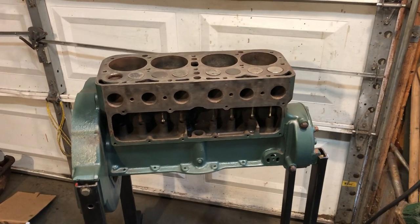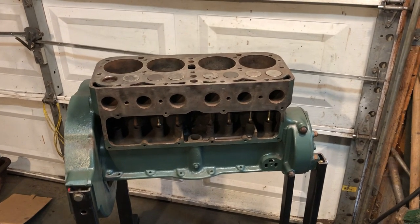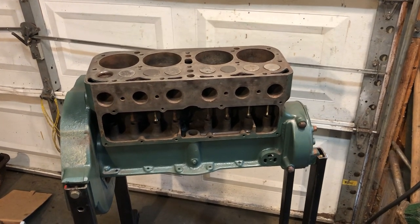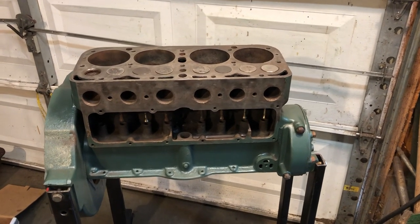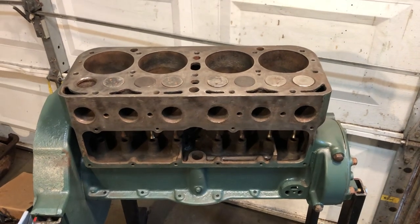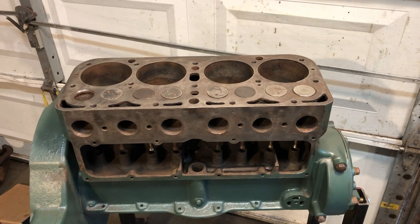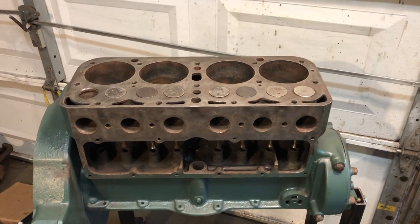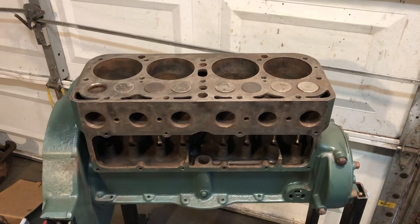It's going to take me a few days to do all that bearing work. It's slow and tedious, but I purposely go slow to make sure that I get the bearings just the way I like them. I like them just a little bit snug, and so that takes a little bit of time trying lots of different combinations of shims to get it just right.